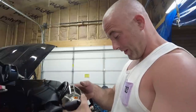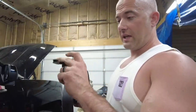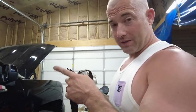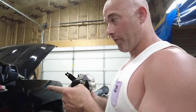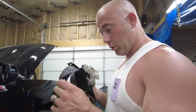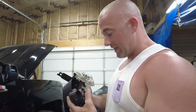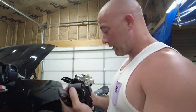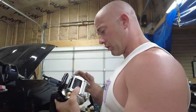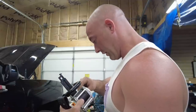Then, on top of that, this part right here, how it hooks in, is latched into an anchor on the seat. So I still had to take the plastic cover off of the seat there. And there's a charge in there hooked to this anchor. Whenever it blows, it pulls this tight, so it pulls your seatbelt even tighter on you. So there's two charges that have to be reset in these things. They put a new cartridge in or something like that, and it resets them.